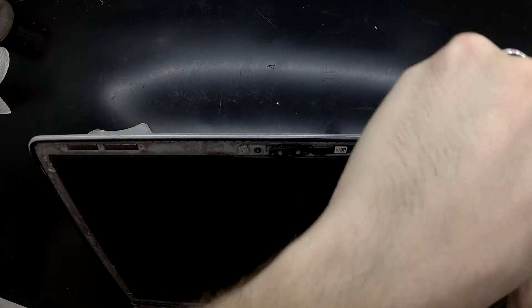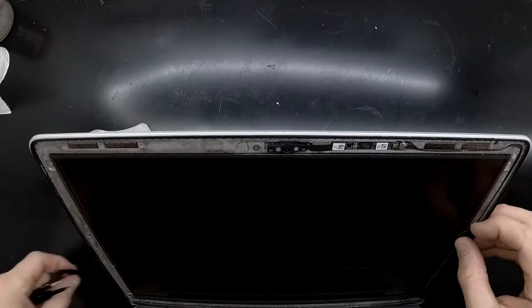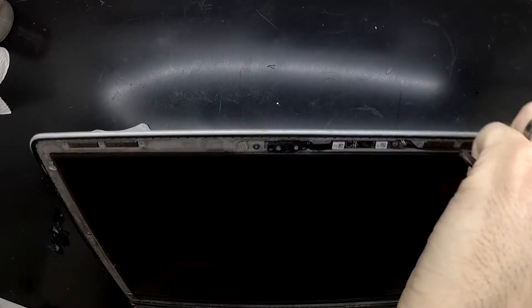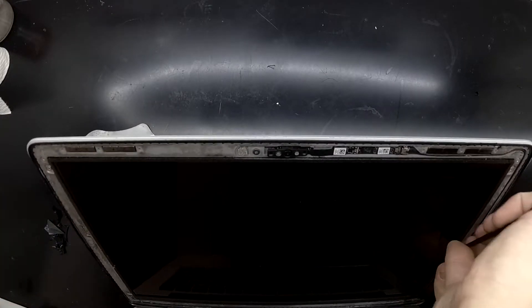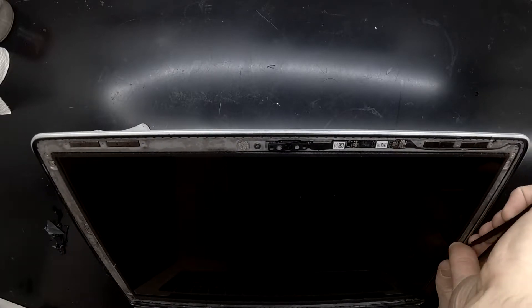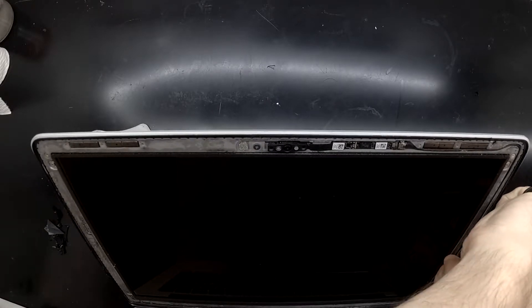From there I would give it a clean with a microfiber cloth, and then install the new panel. One thing I don't like about the new panels is they're almost vacuum sealed, so you've got to peel off the plastic off the back. As soon as you peel that off it becomes staticky and you've essentially got to clean both sides of the screen to remove all dust before you put it down — it turns into a not very fun job near the end, no matter how hard you try, but it should be achievable and get to a satisfactory level.